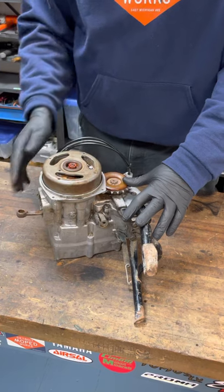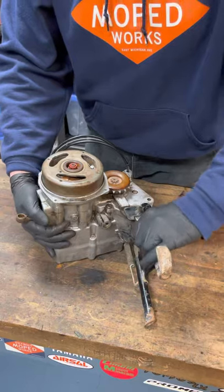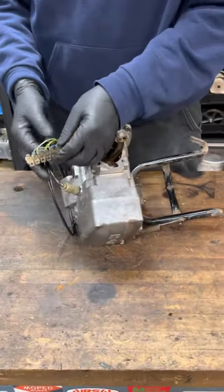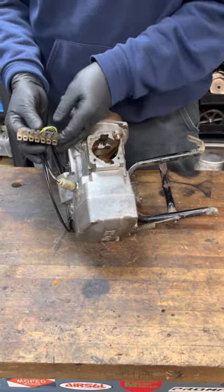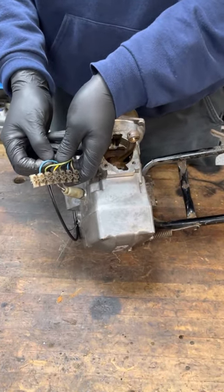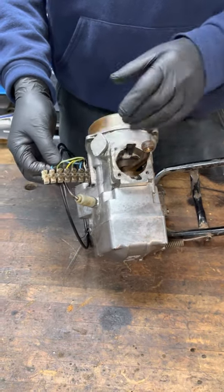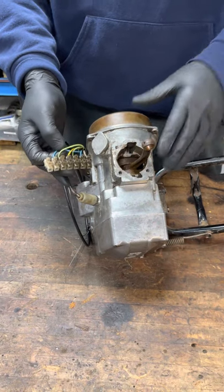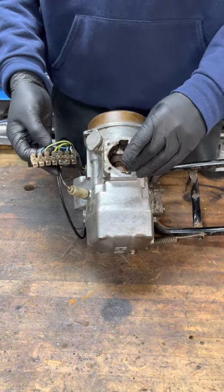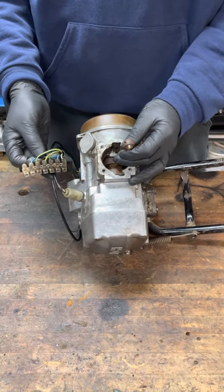Now that we know that the crankshaft turns and that your points open and close, I'm going to come over to the wiring harness on it. Definitely with all of the Puchs and with a number of these other large taper Bosch, what you're going to be looking to do is to get a ground out of your blue wire that's got the black stripe on it. The stock wiring harness has this running up through your horn and back. So you might find that on a Puch moped sometimes you lose spark, and the reason is because you have a bad ground — that's because of a malfunctioning horn or horn switch.